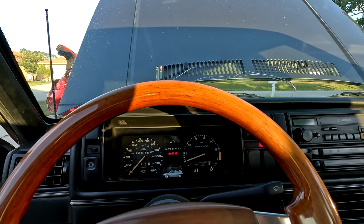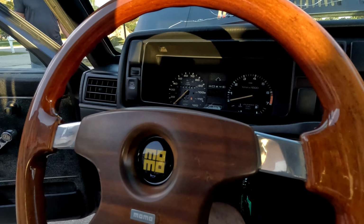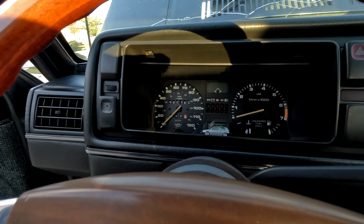All right, I think the battery might need some more juice. Maybe I'll actually jump it, but it's close. Is that a jump pack also? No, just a charger. We're close. It's cranking, sounds fine. Probably gotta build up pressure. It's been sitting for, how long has it been here? Like 5 months, I think? About 5 months. Yeah, so she's been sitting for a minute, but she's fine. The cranking sounds good. It just needs a little bit more fuel pressure, sounds like, but we'll get it going.